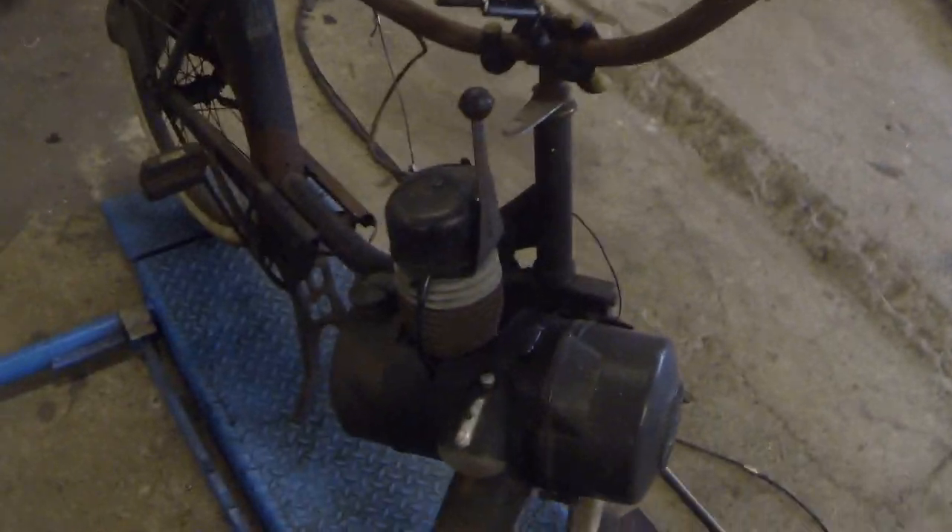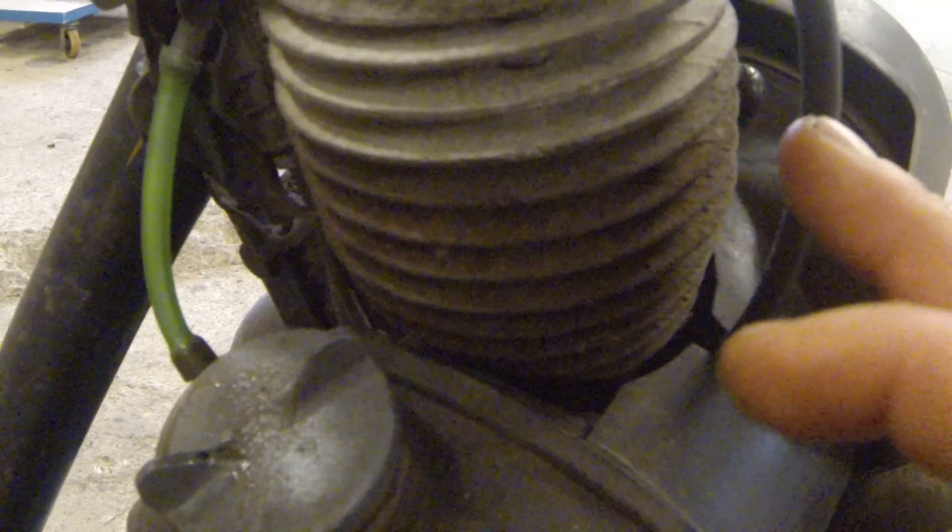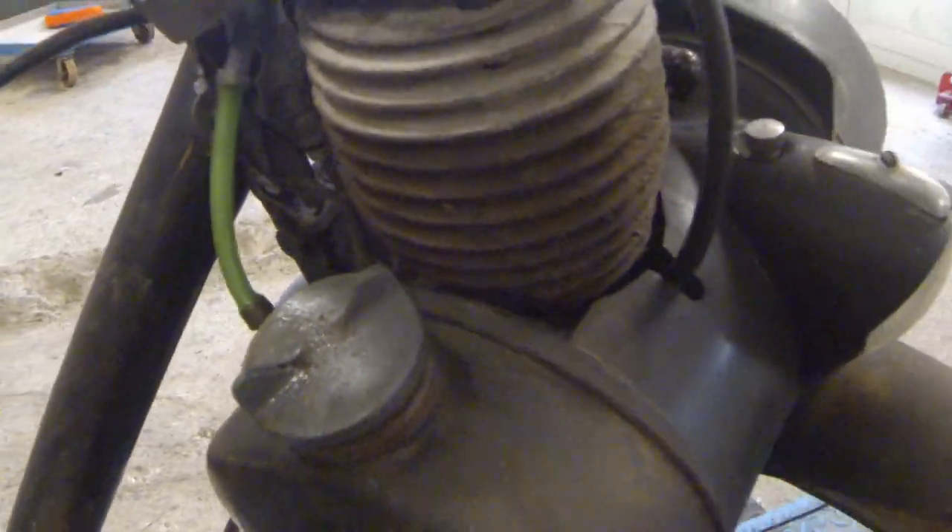Maybe a little bit more top speed as well. Right now my moped is running around 27–28 kilometers per hour, which is pretty good for a Velo Solex. But it's got no power uphills. I don't expect this to make much difference, but I'm going to try to fit it and compare it to the old one. Today we're going to remove the air filter, change the barrel to the aluminum one, test it, and see if it makes any difference.